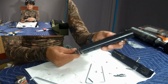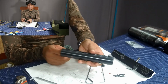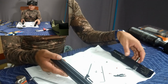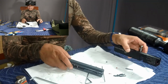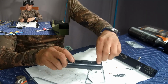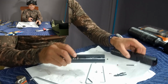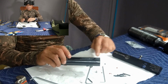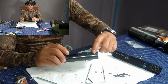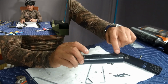Make sure that this end is all the way in, okay, and pay attention that you don't lose any pieces. And when I say any pieces, it's this piece right here. There's an O-ring, and this is your transfer port that goes there, so be careful. Behind, this one has no o-ring here, but on the other side there is an o-ring. We're not going to mess with it. And this is how you should assemble it, with this transfer port that is plastic.